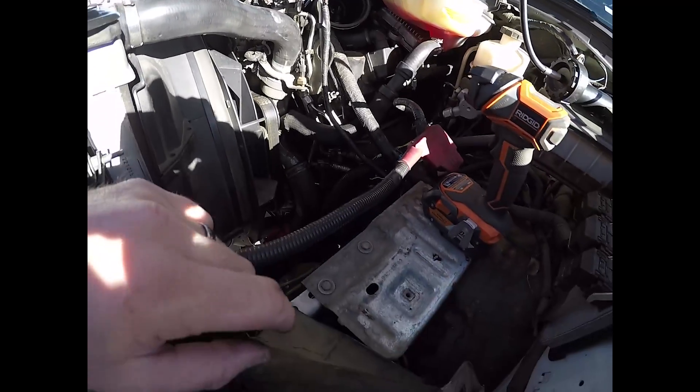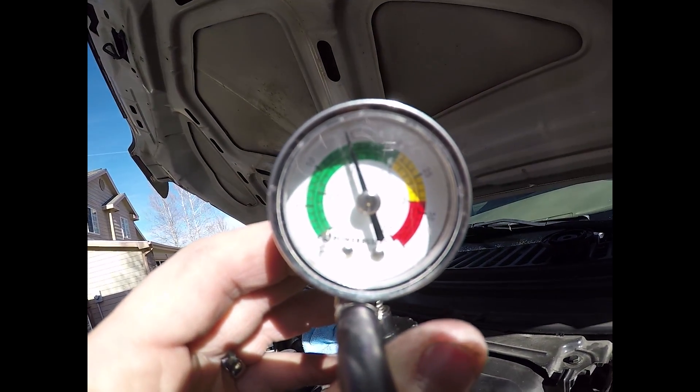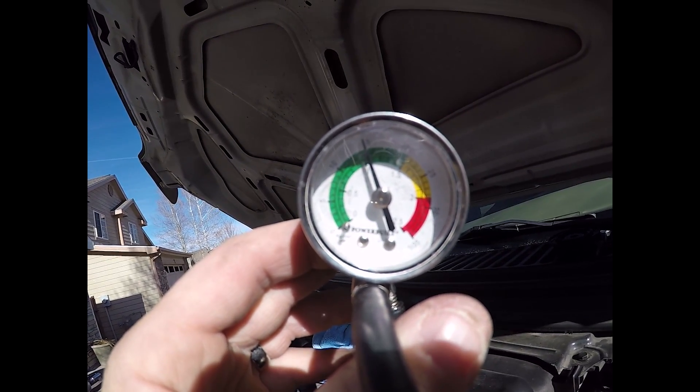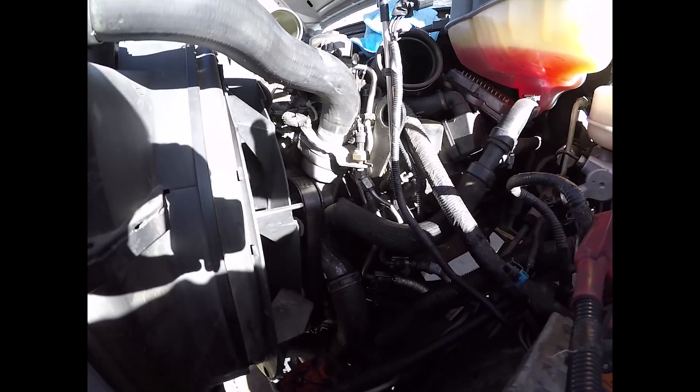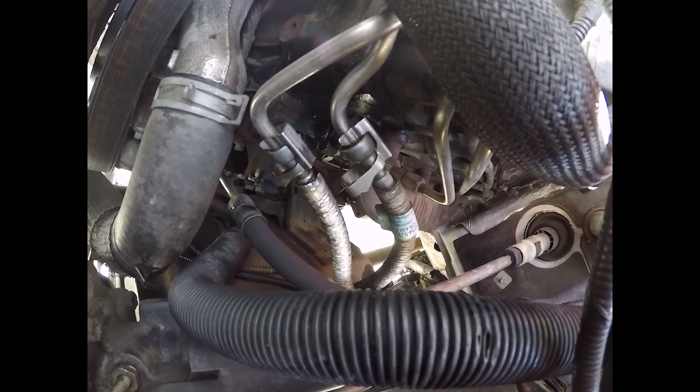I made some more room in here — got rid of the battery and air filter housing so we can get a better look. My gauge is still reading 14 psi, so it's not losing pressure at all, meaning the leak is very minor. At first I thought oh crap, my head gasket's leaking — you can kind of see under there that it's wet around the head. But looking closer, my thermostat housing — you can kind of see it's dripping right there at the back, onto that fuel line which runs right along the head and then drips down. So that's a relief — it's just the thermostat housing.